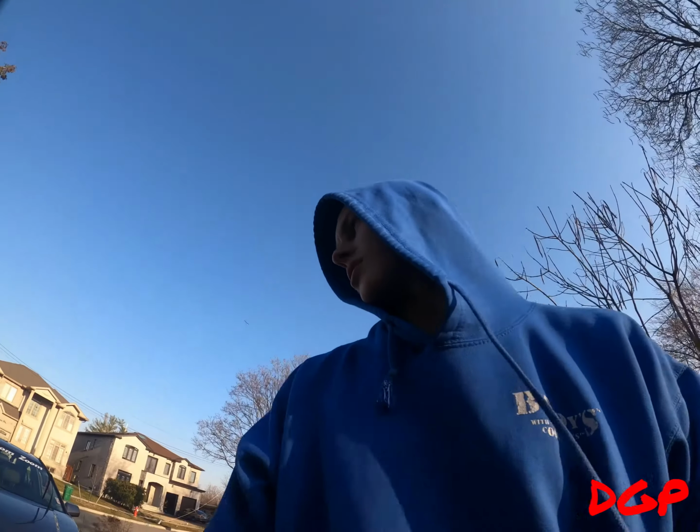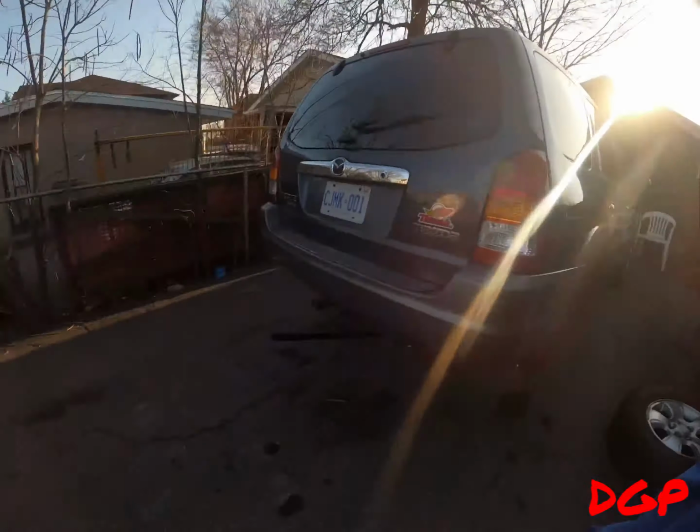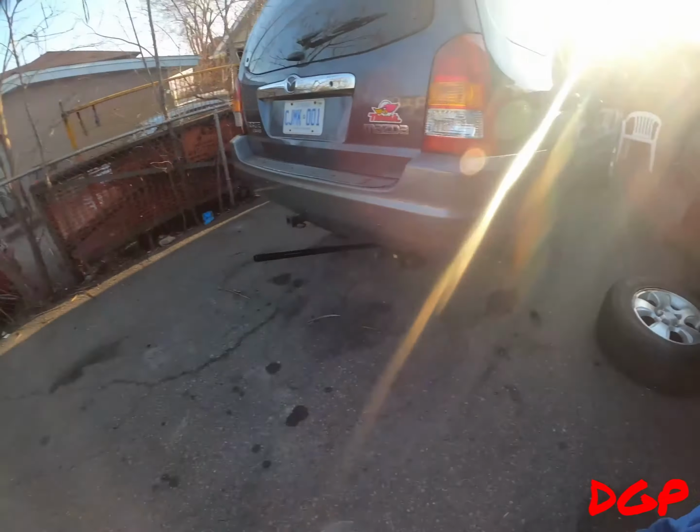So now pretty much the car is almost dry outside. Let me give you guys a small update on the cars and why everything's dismantled again. That one's not dismantled, but it's not healthy. I believe the chain's a little stretched, which is not good. Sorry for the shaky camera. I don't tend to drive it hard at the moment because I want to get a new timing chain for it.